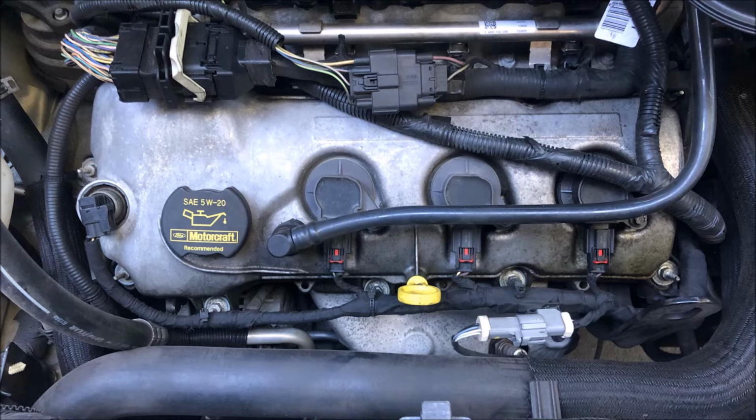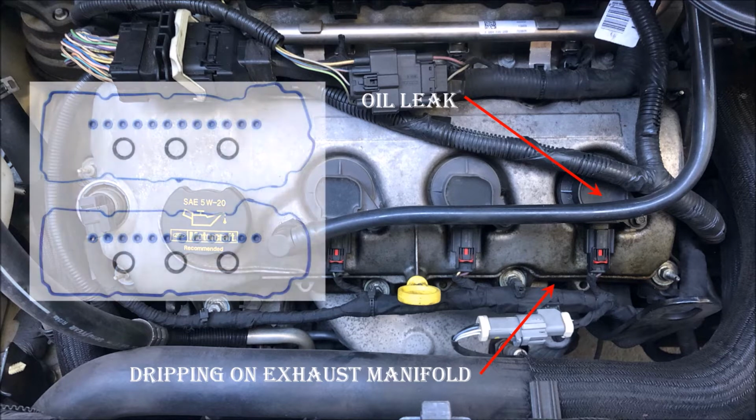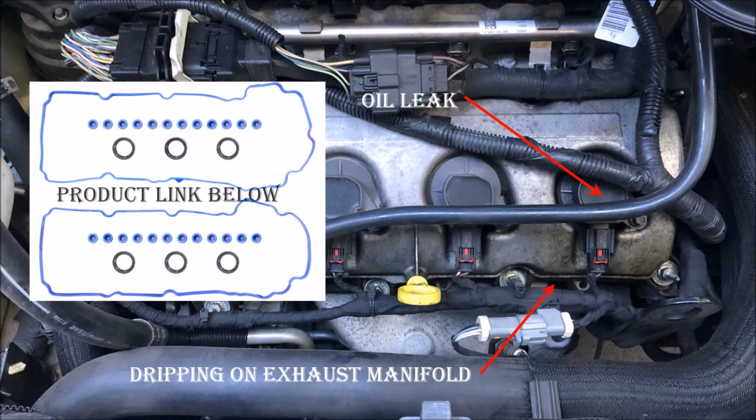As soon as I opened the hood, I saw the telltale signs of an oil leak around one of the coil packs that was dripping onto the exhaust manifold. When I pulled the coil, I saw oil in the spark plug well, indicating the seal around the spark plug was leaking. I ordered a cam cover gasket kit from Amazon, which I'll link below.